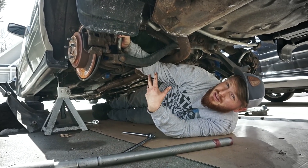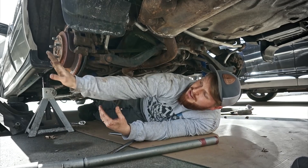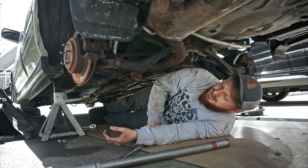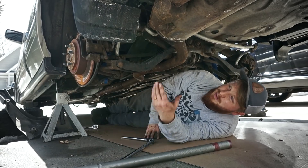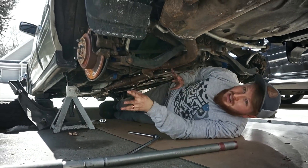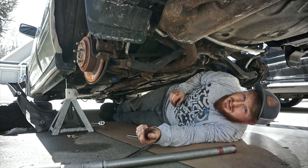The custom knuckle will mount to all the stock Subaru suspension components. I'll have to offset it because the Explorer axles are about an inch or two wider, so it'll push out a little farther. But there's a lot of space on the body so I can still fit a tire underneath it. I'm hoping it'll look stock from the outside and you won't be able to tell.